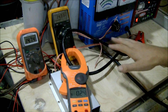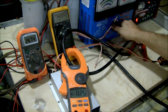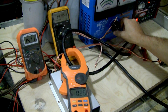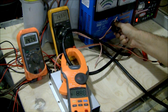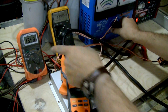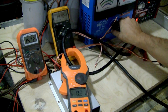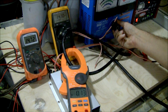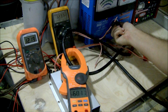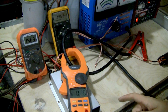I've got it connected to the cap directly and we're going to start with a very small draw. You can watch the amperage here — that's only 18 amps of draw. It doesn't affect it a whole lot because we've got the 25 amp charger. If we go more than that, now it goes to 46. Then up to 60 amps or so — 12.1 versus 12.6. So the cap was a half volt lower than the battery itself.